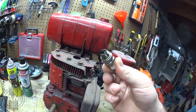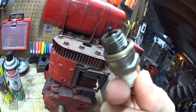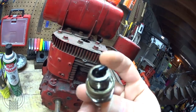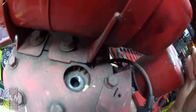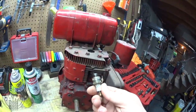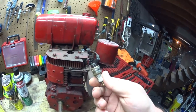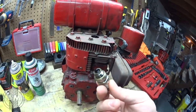Here's another thing that you can look for. I just pulled this out and it is coated in oil. It's definitely not old gas, it's definitely oil. So when this was put away somebody may have squirted a little oil in there just to keep everything from seizing up. So we're going to clean this up and stick it back in here and put it on the ground and see if we can get it to make some sparks.